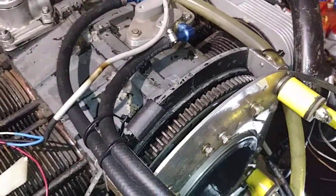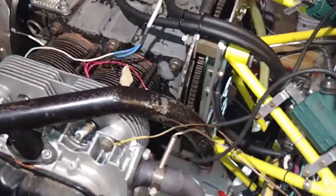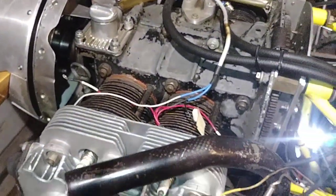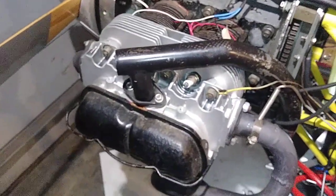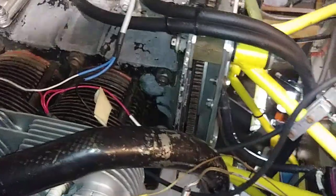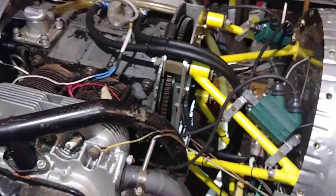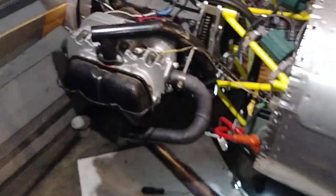I'm pretty sure it ain't the engine, but I may still get another engine because this thing sure leaks - so either another engine or rebuild this one, and see if I put a bigger crank in it to make it a 2180, because it's already got 92 jugs. Carbs are off too, but didn't have to take the exhaust off. To pull the engine I've gotta do all that anyway - so there's an update on what's happened to the H5.